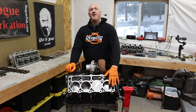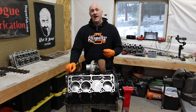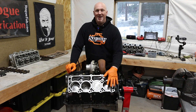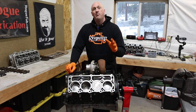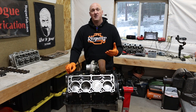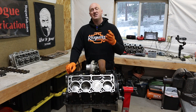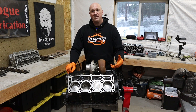If you think about this engine right here — this is a 5.7 liter Hemi engine, 345 cubic inches. What that means is that for every single cycle of this engine where all of the pistons have gone through an intake stroke, at a maximum you're talking about 345 cubic inches of air entering this engine. But no engine is 100% efficient — it's called volumetric efficiency. If an engine is poorly designed, you're probably in the 70-odd percent range. If it's adequately designed, around 80-some-odd percent. And if it's very well designed, maybe low 90% volumetric efficiency.